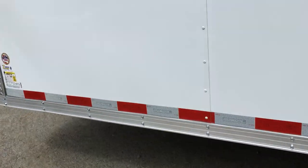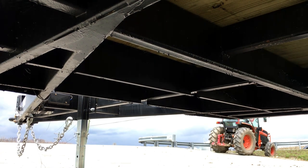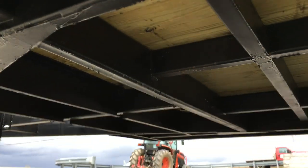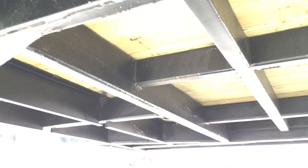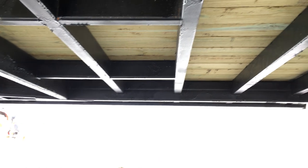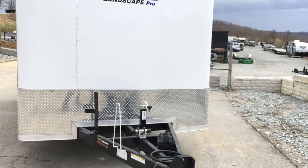Let's take a look up front — I want to show you how they frame this out. You don't generally see this underneath an enclosed cargo: a lot of details like a frame gusset, and they use a tubular header. All the reinforcement work Short Track does underneath these is very impressive. Another detail: your outriggers. You've got a frame rail built on a 7-wide chassis; the outriggers are generally made out of formed steel, but these are made out of box tube steel — 2x6 box tube. So the outriggers here are box tube rather than formed. Sixteen-on-center studs; sometimes guys will order a 12-inch on-center floor, or generally a 16-on-center floor with the box tube.